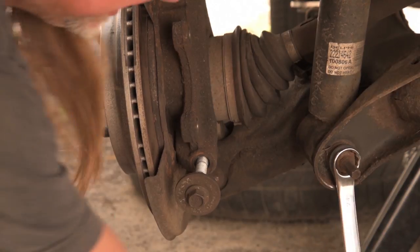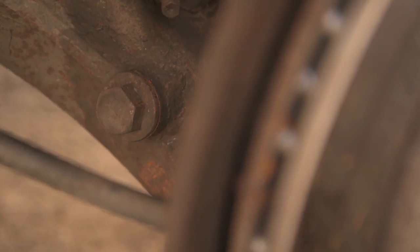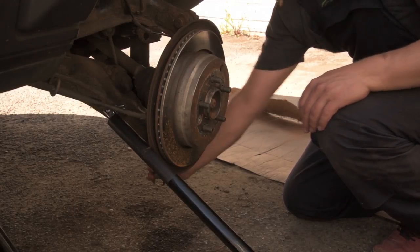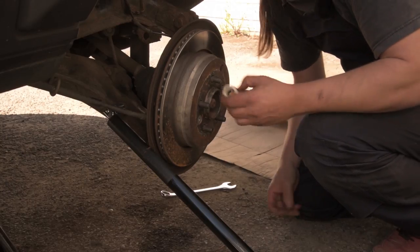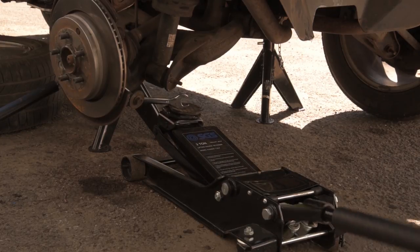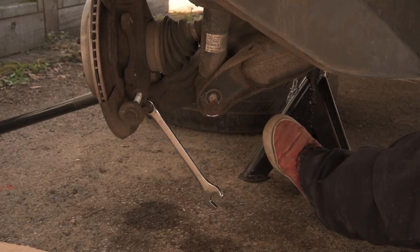Once I'd broken the rust on this nut, it took me a good few turns to realise I'd forgotten to hold the bolt, which was spinning on the other side. Right, made some progress. I've managed to take the nut off the bottom of the dampener. The bottom knuckle joint is not moving at all. I've had my feet on it, pushed, nearly knocked the fence over. So I'm going to do the top one and fold it down to give me better access, hopefully. We'll see how that goes.